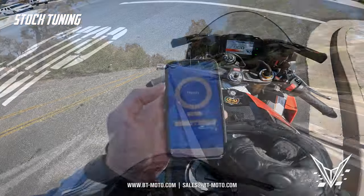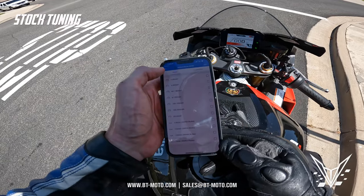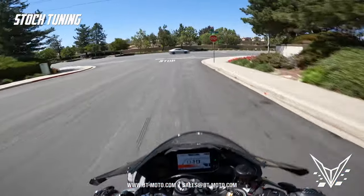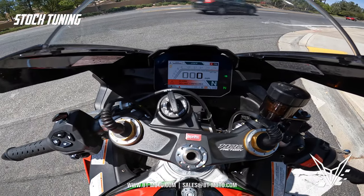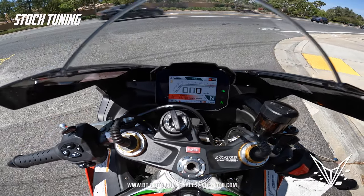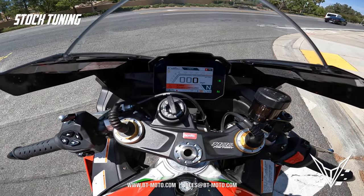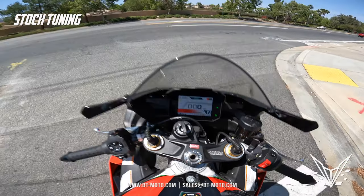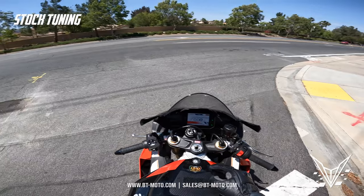Let's get this 60-through-130 done. Draggy is ready, marked off. This is interesting — the bike is stock. It went to 241 degrees, you can see it's 235-234 and cooling right now, and the bike just shut off. This is bone stock, by the way — 241 just idling for about five minutes. Ambient temperature is probably about 75. So I'm going to be sitting here for a little bit while this thing cools down.